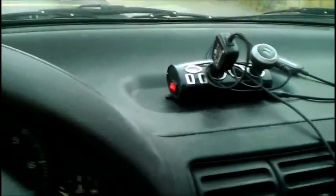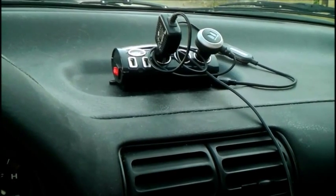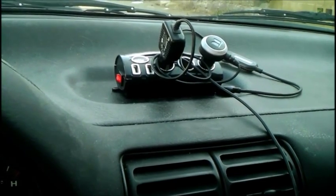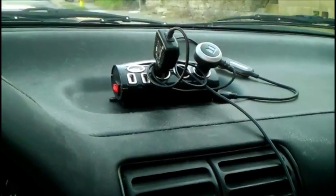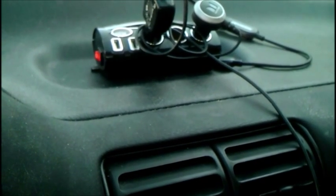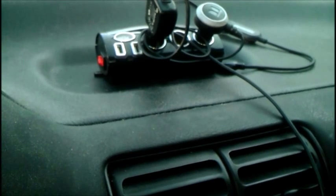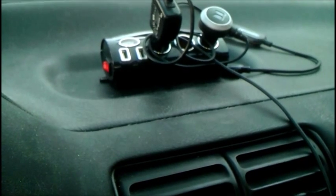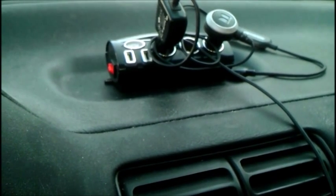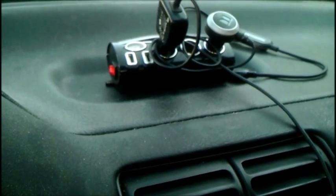Just as a fair warning, these little dash clips are like brass or whatever, held on by plastic, so do be careful. Other pieces you will be removing today would be this upper door trim, the upper door trim here, two lower door trims in the back, and two upholstery trims — each have the same clip setup. So to avoid repeating myself four or five times, I figured I'll go over this fair warning once. After you remove the dashboard, there should be a piece of foam that you have to remove. Remove that and you have your dash trim out of the way.